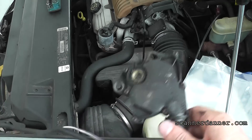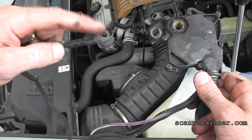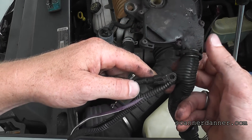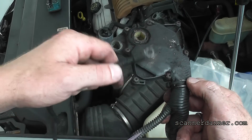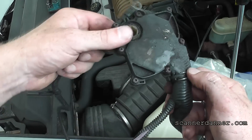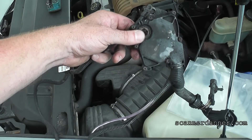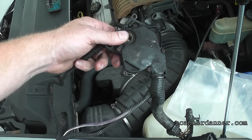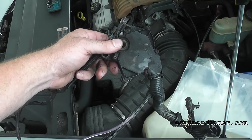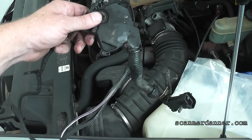I back probed the yellow wire, but coming out of the purple-white there's really no way to test this accurately without poking a small hole in this wire. I could have gone down to the starter and measured zero volts at that inlet, but what does that tell you? If you have zero volts there, it doesn't mean your park neutral switch is bad — you could have an open in the circuit. So you have to test it as close to the switch as possible to be able to condemn it. You check the voltage coming in, you check the voltage coming out. We had good 12 volts in and no voltage coming out. So those people who insist on never poking holes in wires — you don't work in the real world. I am not apologizing for poking a hole in that wire.